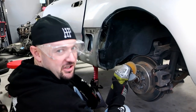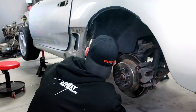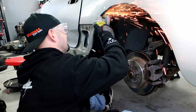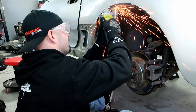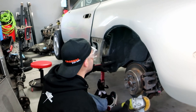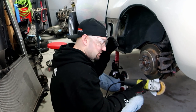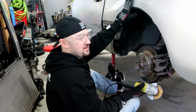You guys can see a spark fly — when you really start to cut, it really goes. The smoke is from me hitting the tape, by the way. And if you are doing this on regular paint, see the smoke itself is bubbling the paint. If I was doing this on my car with good paint, you would want to hit, back off, hit, back off because you're obviously creating a ton of heat — it will bubble your paint. So this is a very time-consuming project if you're going to do this with good fresh paint. But because I don't have that, I don't have to worry about it, which is why you want to do it now and not later.